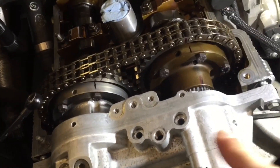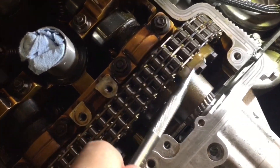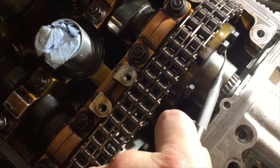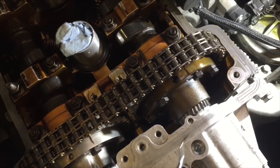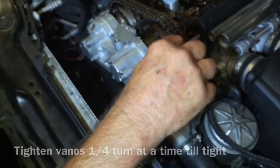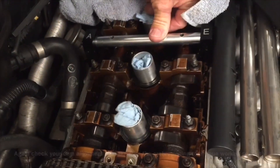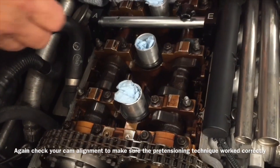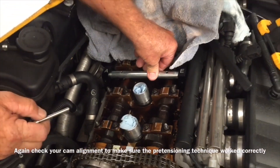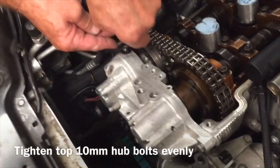We've tightened down these two bolts and backed them off a quarter turn to add some pretension. You can see we've picked up some space — these were originally hand tightened, and because we tightened the others down and put pretension, we've gained this little gap, so we know we've got pretension in that. We're taking this thing down one quarter turn at a time on each side, checking our timing on the cams, and we can confirm they did not move at all. Our pretension technique worked perfectly. Now we're going to start tightening the bolts up on the hubs, and we want to remove this because you don't want to tighten the bolts with that on.